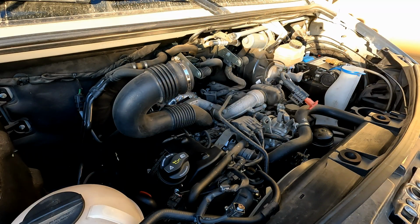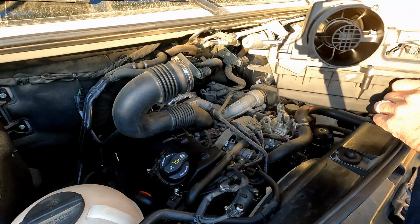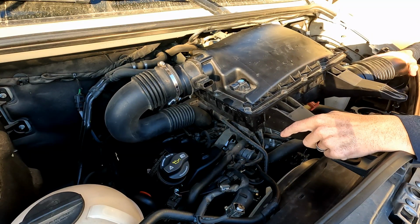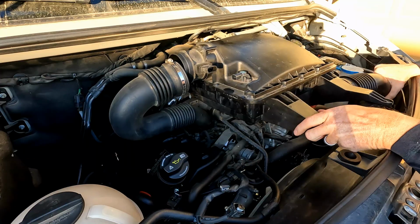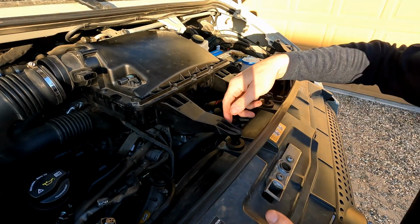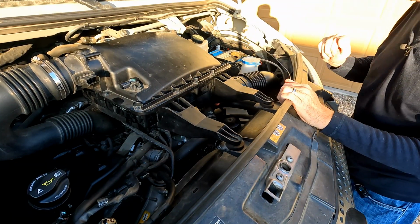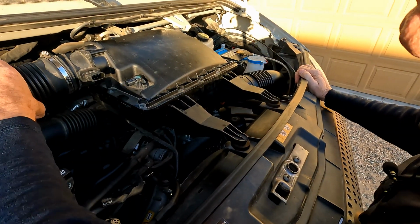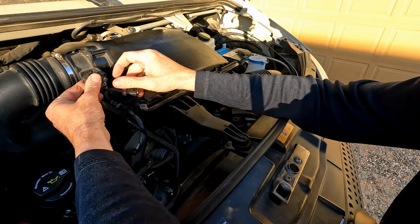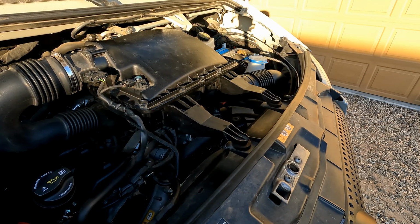Okay, now we're going to drop our airbox back in. If you'll see on the back of the airbox are these notches, and here's these two rubber deals. Those just slide on. So you line those up and push those in. Oops, there we go. Then, if you can see, line these pieces up here, and you just push those back down, and then pop that back in. That is all back. Take your intake hose, push that back on. Take your clip, stick that back on. Push those back in until they click. There we go. So those are all in.